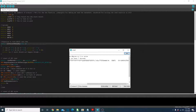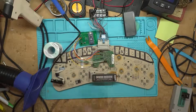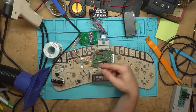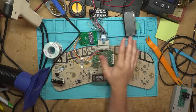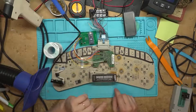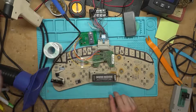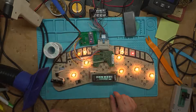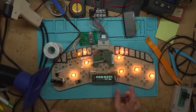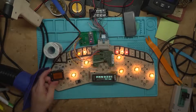Let's switch back to the camera and power it up. I'm willing to bet it's going to say trip zero again, because the trip data is stored on the EEPROM and we did not re-read it before we made changes. So we've put the problem back on there. But it should now boot up showing the trip instead of the odometer. Sure enough — we have trip and it says zero. There's our odometer. So if you change that 0x01 to 0x03, it works, and we didn't give it anything invalid — it's still working correctly.